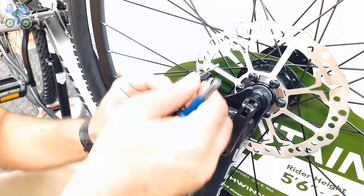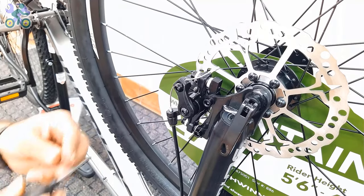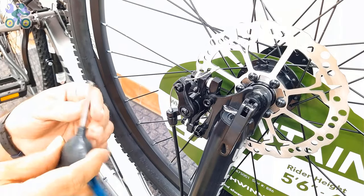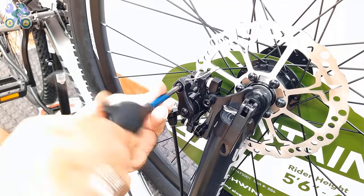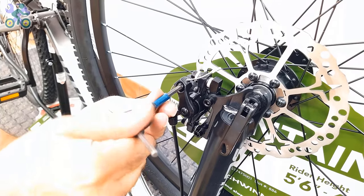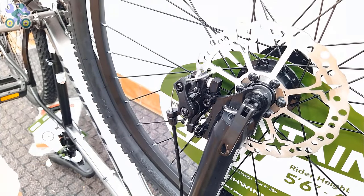If the brake wire was out of place and the brake wire was still loose after tightening the anchor nut, turn the bike upside down to have a better view and put the wire in its place. Adjust the brake, and tighten the nut.